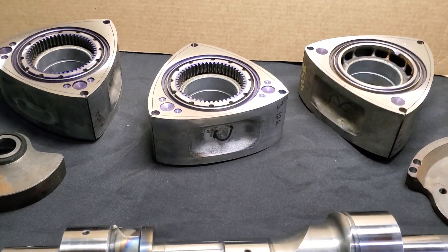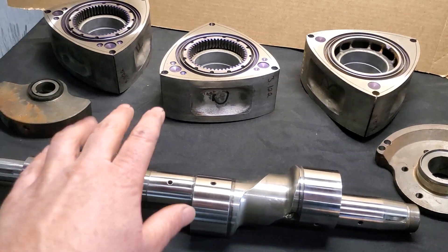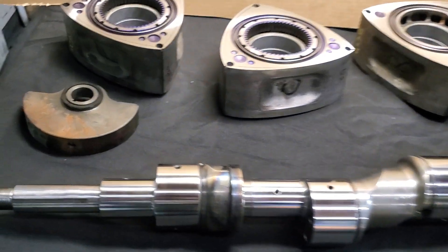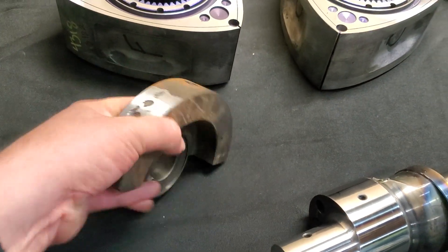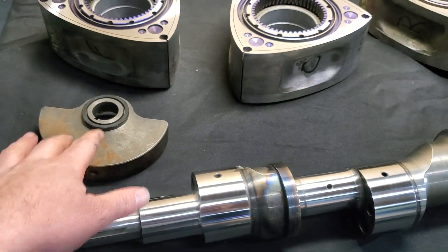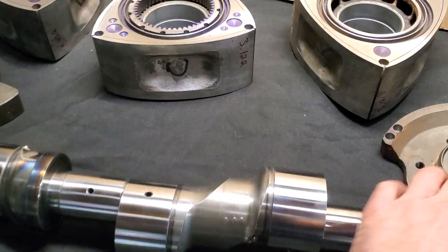So that's a little bit about the balancing process. Because these rotors were third generation rotors, we gave them a sequence — they're matched to the counterweights now. The counterweights are where the work was done. In the case of the front counterweight, we actually had to add heavy metal — Mallory metal went into this — to adjust the weight enough to get paired with the now-matching FD3S rotors.